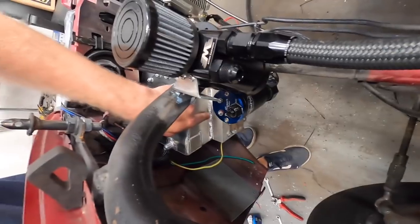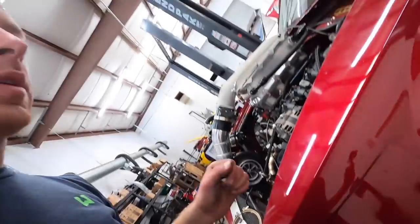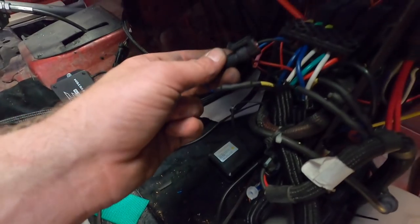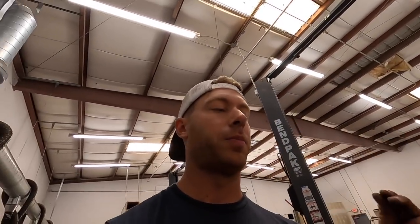The race fuel pumps are mounted right here on the race fuel tank on a bracket Ty made. I just need to run wire and the fuel pumps are ready. Since they're running off the switch, I got some pigtails and connected them so for the street pump I have one connector, and when I want to switch over to the race fuel pumps I just plug in the matching pigtail. It's an easy connector — just plug and unplug when I get to the track.